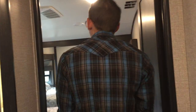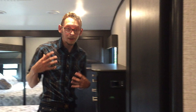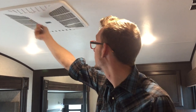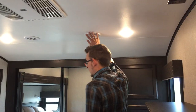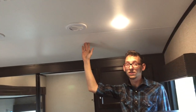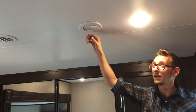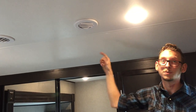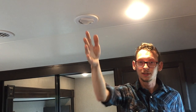This is about as loud as the AC is going to get. This is a Coleman Mach air — it's a direct blow down but it's also ducted, so you can close these off and it'll force air through the duct work. These ducts continue a bit further at the end so all the air doesn't get forced down the very last one — it goes in, hits the end cap, spirals back, and evenly distributes throughout the coach. That's just something that Jayco does.